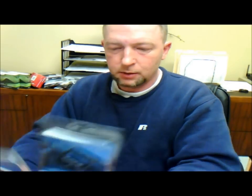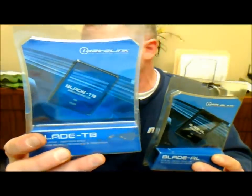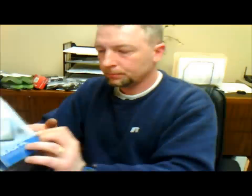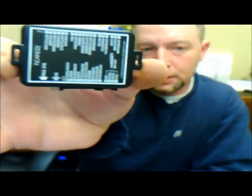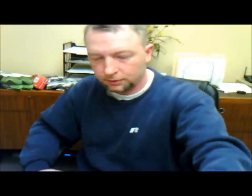So we've covered iDataLink, the Blade, the AL, and the TB. The Blade TB is the same as the ADS-TB in the regular iDataLink bypass. The Blade AL would be the same as an ADS ALCA - or technically the same as an OL-MDB-O in Omega Link. The Flash Logic looks exactly the same as Omega Link or iDataLink - color codes, pins, everything exactly the same. FL-CAN is the same thing as an ADS ALCA. The only thing that changes is the four-pin data-to-data plug.